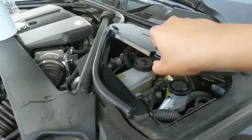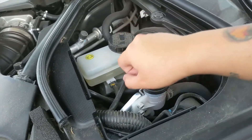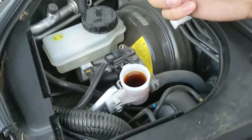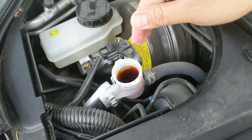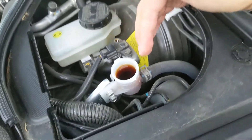The CSC is inside the transmission bell housing — that's the problem with the Z. So what we're gonna do is a little bit of preventative maintenance. We're losing sunlight so we're gonna do this as fast as we can. The brake fluid reservoir and clutch fluid reservoir are side by side. Let's inspect inside — see that? That color is a no-go. We're gonna replace this fluid with a new fresh one that can tolerate really high temperature so it doesn't burn like this. It looks like McDonald's coffee.